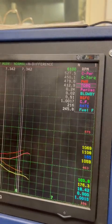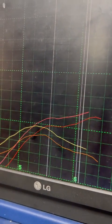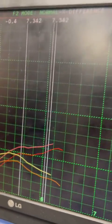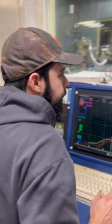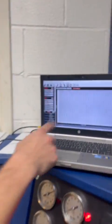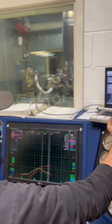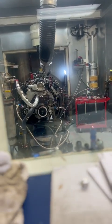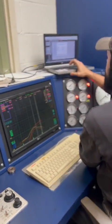We're looking at our yellow line versus our pinkish line — the run we just did versus the truck manifold. The truck manifold is actually better everywhere. The tune's not optimized for this manifold — it was set up for the truck tune, so we're gonna have to clean some things up from the fuel table. We'll look at the data and see what we got. Part of the process we do on every single motor we build here at MTI — test everything, break it in, make sure she's running how we want her to.